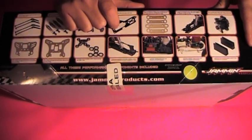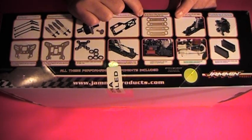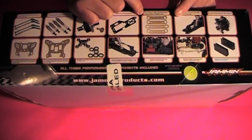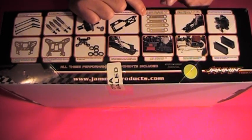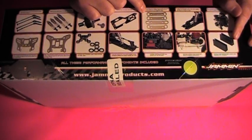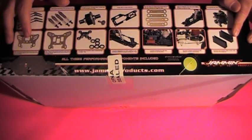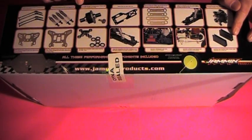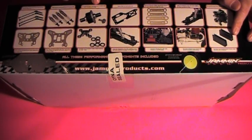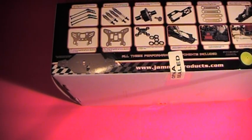You're familiar with those Jammin adjustments. The front and rear arm holders are hard anodized aluminum with cam inserts for multiple adjustments for toe-in and for the anti-squat front arm angle. Adjustable CNC machined hard anodized front and rear holders. The all metal gears throughout the drive — no plastic gears in the entire drive train.